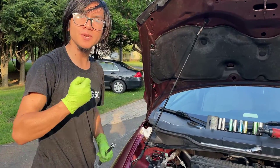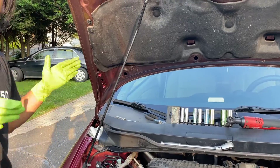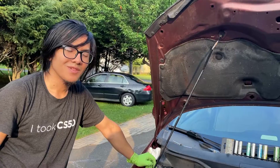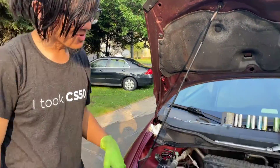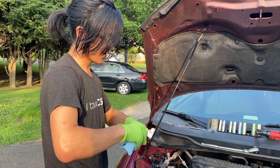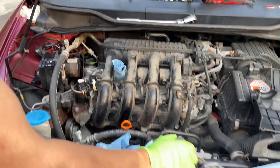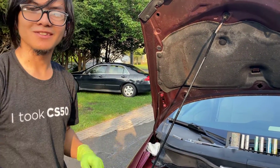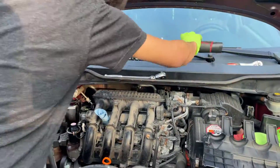One thing you want to do after you take out the spark plug: make sure these holes don't get contaminated. You have two options — one is to cover them with a paper towel stuffed inside to prevent any contaminants from getting in. Another option is to use compressed air and blow out the hole. My dad notes that the blowing air thing is a point of contention, so to be safe, roll up a clean paper towel and stuff it inside. You can also cover the hole with the ignition coil you just took out.